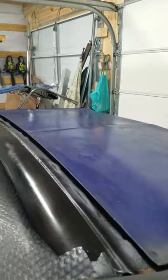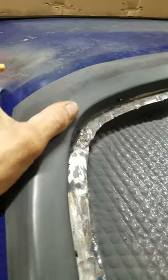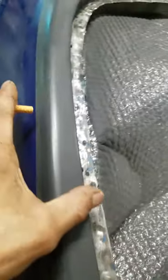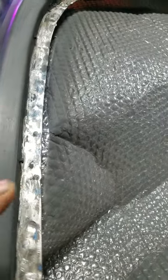This is a little update about my window installation. My guy is supposed to be here in a little bit. What I've been working on today was getting the track ready — the sill for the rear window. What I've done was took it all down to bare metal up in here and went and put automobile primer on it, because after that trim is on it's going to be so hard.